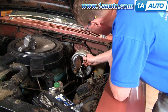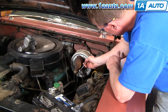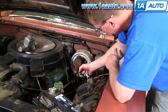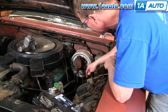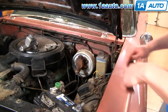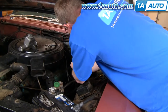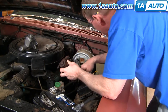You just have to be careful, especially on these older cars, because they don't make the lines for them. You have to be careful when you take these apart because the fitting can be seized onto the hose and you can end up breaking the hose. This line wouldn't be that bad of a job because it's pretty short and you can probably remake it pretty accurately. I've got the line unhooked and the bolts off — just going to shake, pull, and pull off the old master cylinder.